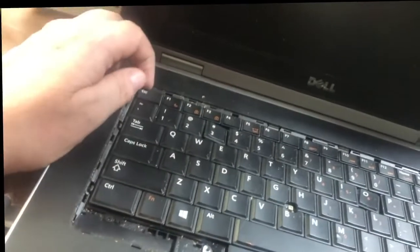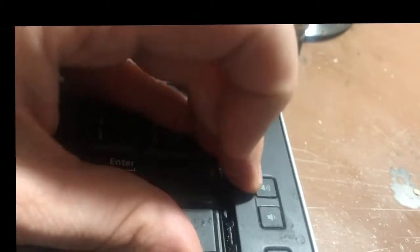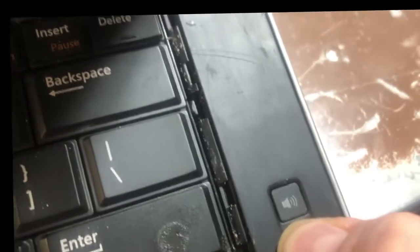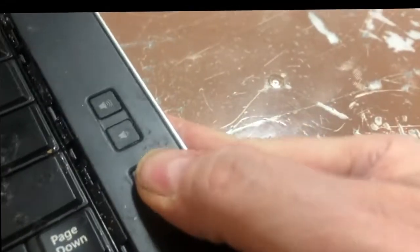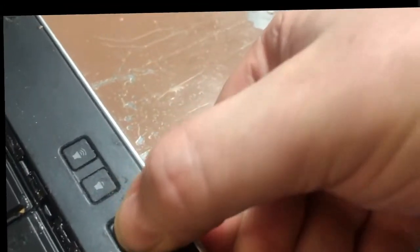I checked the iFixit instructions and I replaced it. I got a replacement keyboard from Dell and it's coming. This keyboard - this computer's previous owner was a smoker, and unfortunately you can see the keys are sticking and they don't work. This key here does not go up and down - it's stuck. So I'm going to have to clean this key out too, maybe with some rubbing alcohol. And there's another key over here that's stuck too. I'm going to have to clean all these keys out.